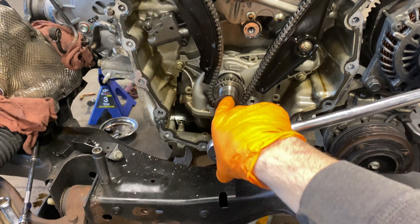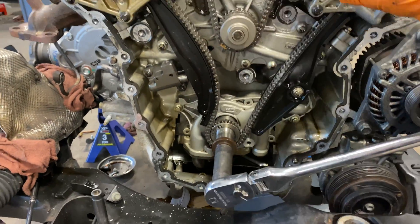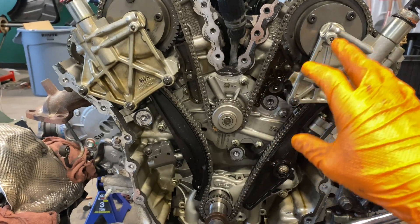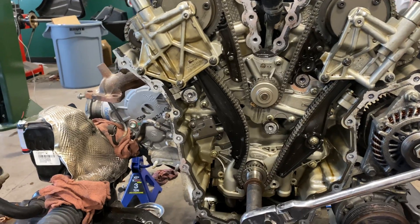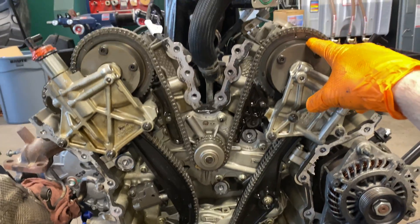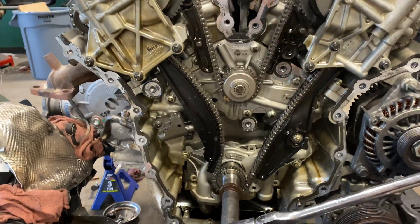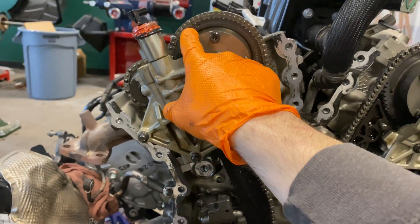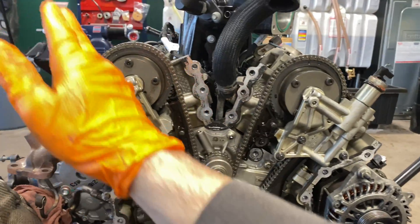You are going to have to run the crankshaft bolt back in. There is a service procedure — I don't want you to just watch this video and copy exactly how I do it, because some are configured a little differently. That said, you're going to need the camshaft holding tool, which I'll show you in a minute. Basically, you're going to turn this over until your marks are both vertical with each cylinder head.